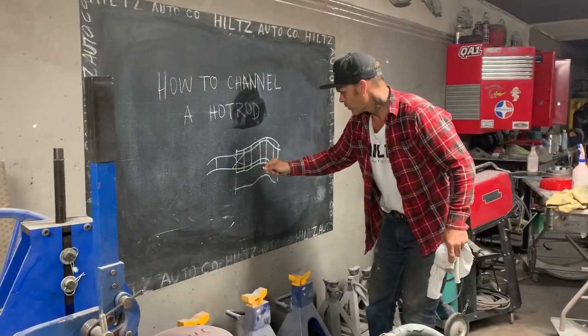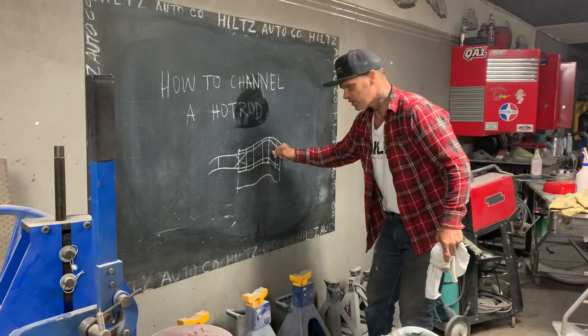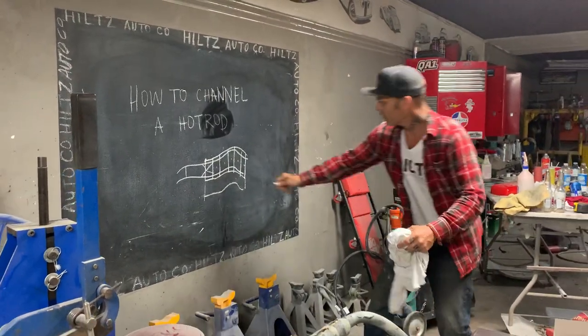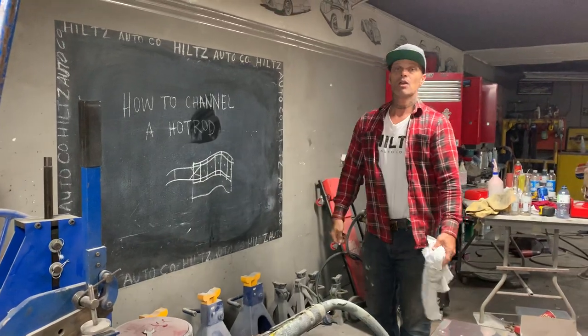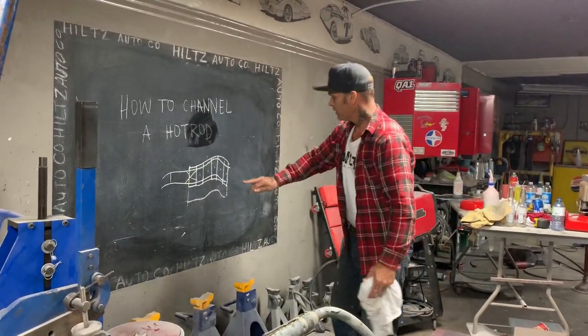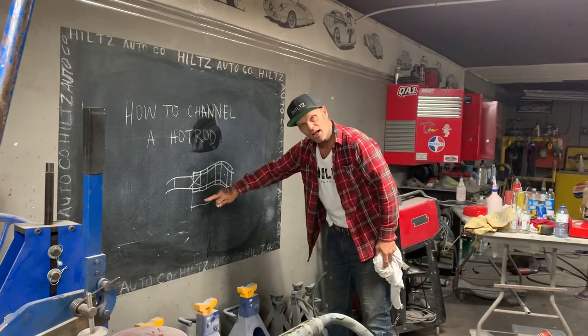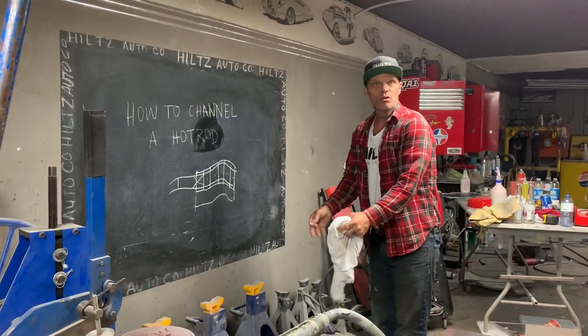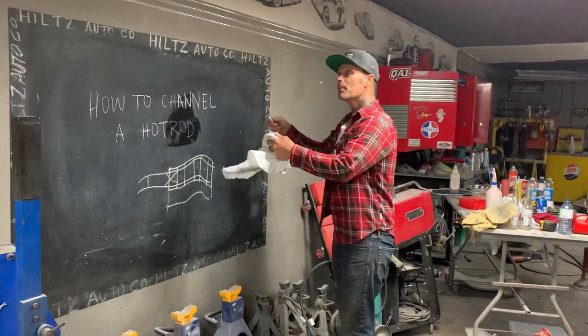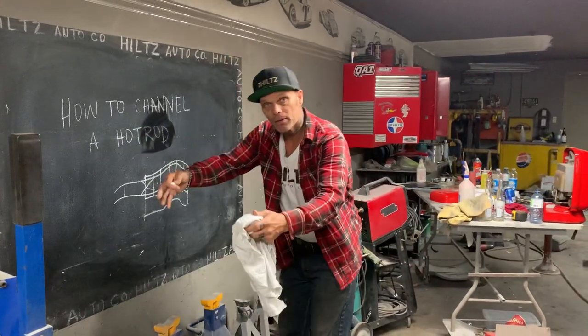There's a floor pan, and another floor pan. As you make them floor pans and you weld the apron on the side, you will be able to take that off and put it back on. It'll fit perfectly. With the aprons on the side of it welded, it allows you to take that hot rod that has no floor in it, to pick it up and set it on top of that floor,